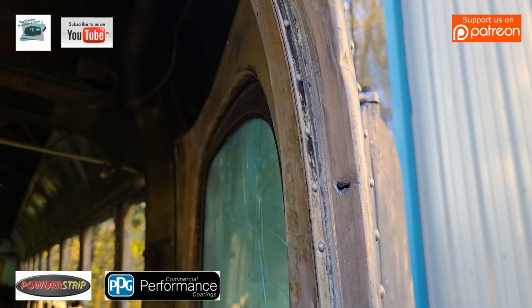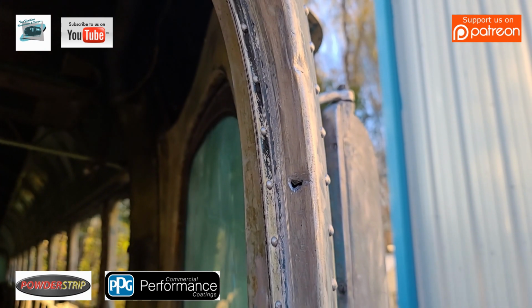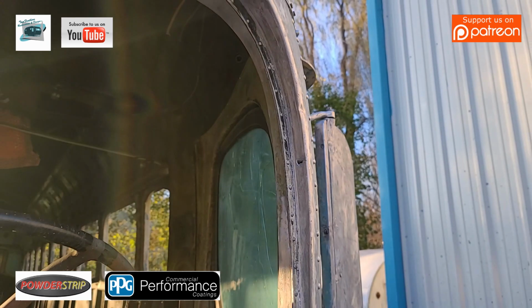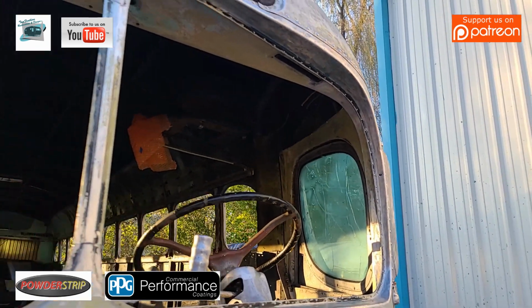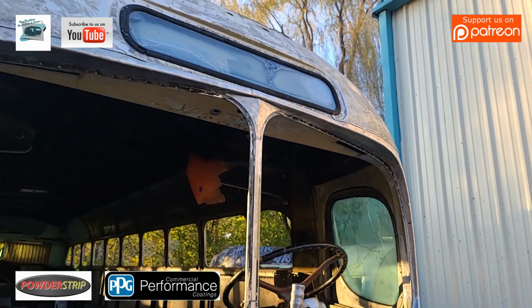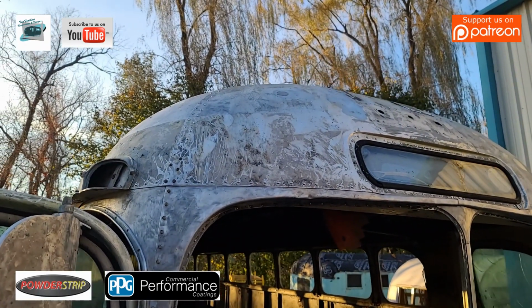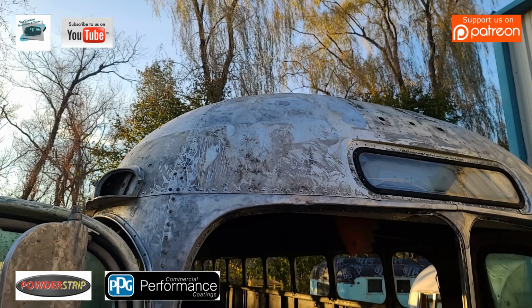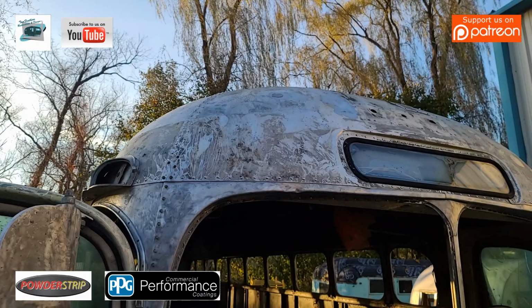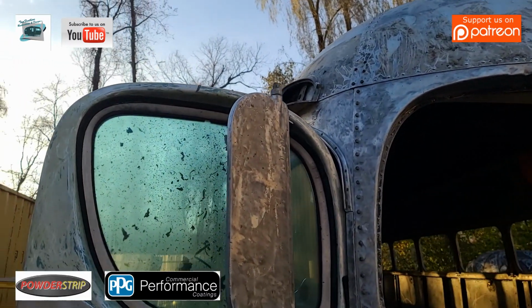Now this is kind of cool. When you strip the bus, here's a nick in the body, and it had filler in it, and because we stripped it, that filler came out. So we'll make that repair. We already know we're going to do some lead work up top here, even though we've popped out in previous episodes most of all these dents up front. They're as popped out as we can get them now, so it's as near perfect as possible to the original bus.